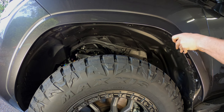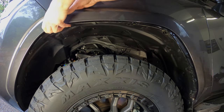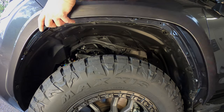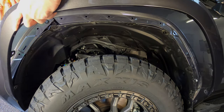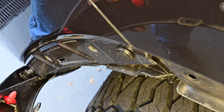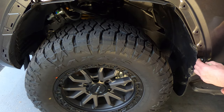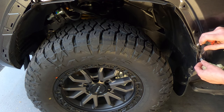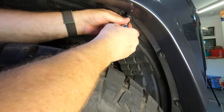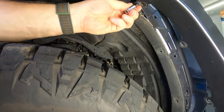With all the clips and screws out, remove the trim — it's held in place by spring clips and can be removed by pulling the trim directly outwards from the vehicle. This is best done with just your hands and fingers starting at the rear end of the trim and working your way up towards the front. Once you get to the last 10 centimetres or so, use a large flat blade screwdriver to lever off the last two clips. Double check all clips have come out of the guard and remove any remaining with a trim tool. If you have the OTA aftermarket flares, remove the five clips in the guard followed by the two allen head screws, then lift the flare off the car.